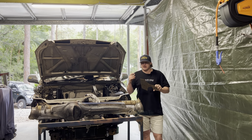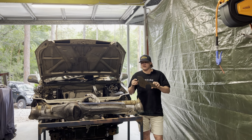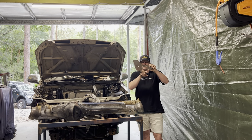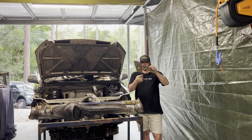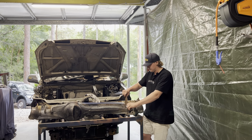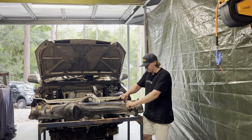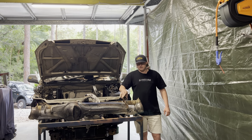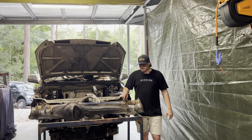So eventually down the road with custom arms, I'll be doing hydro bumps straight to the housing, but that's going to get lopped off there. You can see the general shape in here goes more than halfway around. Instead of stopping about here, we have the extra tail on it. So when this sits around, you can just pop it on, but now you can't actually pull it off because you've got the shape trying to hold it on there. So that's going to be a lot stronger.